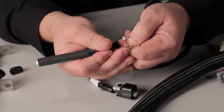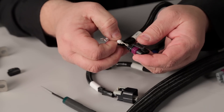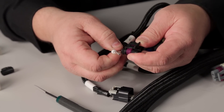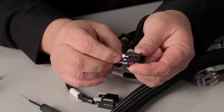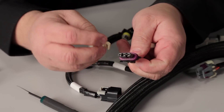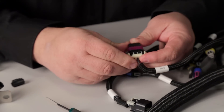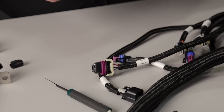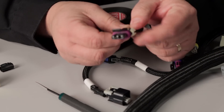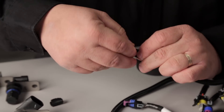You don't want to bend it too far, and you definitely don't want to break it off. If you do accidentally damage the connector or the pins, they are available from Holley or your local Holley dealer. You would then carefully reinsert the connector, line it up, push it in gently until you hear it click, and do the same thing on the second wire. Once you get those installed, you can reinstall the TPA. Be careful and make sure that you get the wires separated. Lock that back in, then take a little bit of electrical tape — I use good quality harness tape, it's worth the extra expense to buy quality materials. And you're good to go.